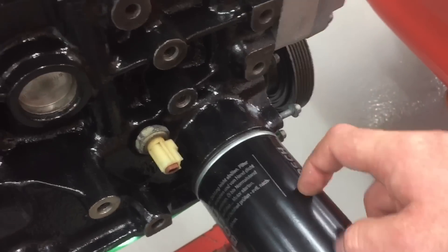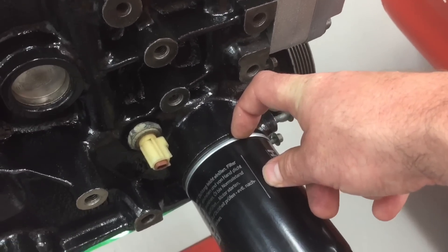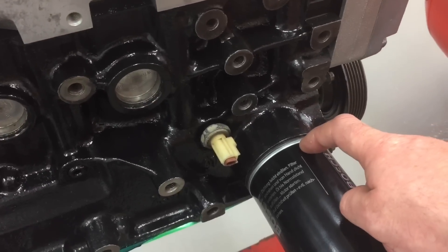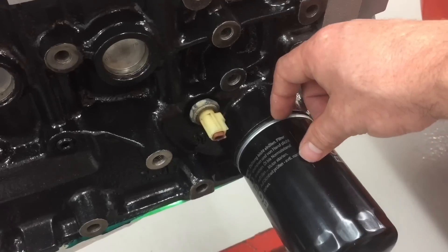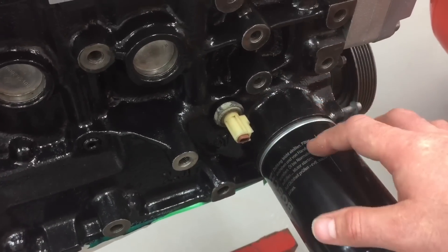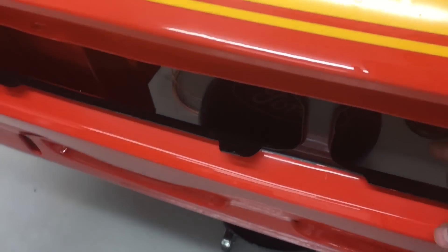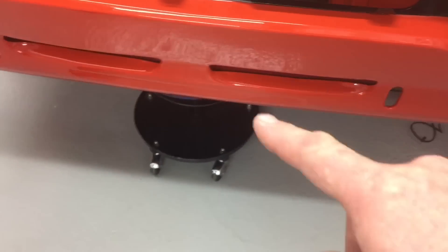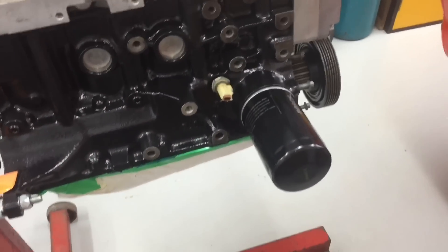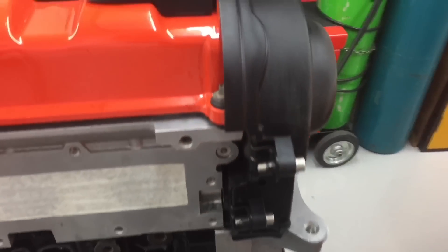In the Focus, between the oil filter and the block, there was a water-to-oil cooler which used coolant to cool the oil. I've done away with that and I'm replacing it with a sandwich plate that goes in the same location, with two pipe fittings that you can run hoses from to an external oil cooler. I'll mount that probably behind one of the vents in the front panel — out of sight but providing decent cooling for the ST motor.